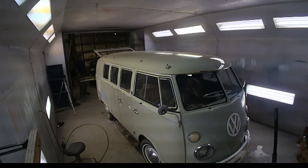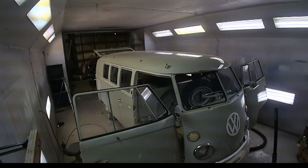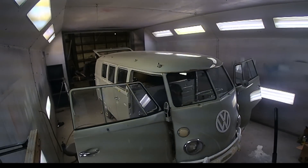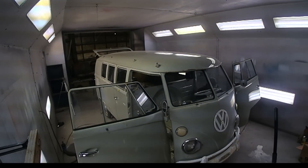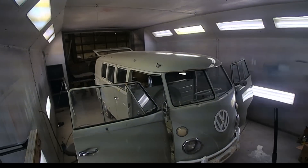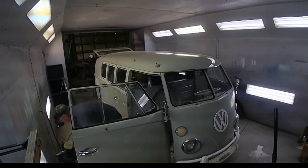There was a lot of dirt and grime down around the cylinder walls, so we cleaned all that up so it would cool properly. We rebuilt the carburetor, put it all back together right down to the stock governor that the bus originally came with, put the motor in, and it just runs great.